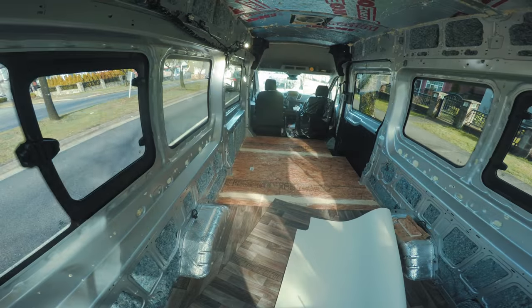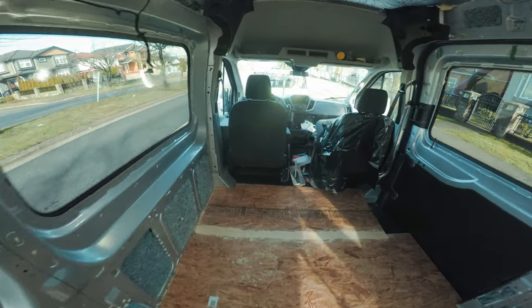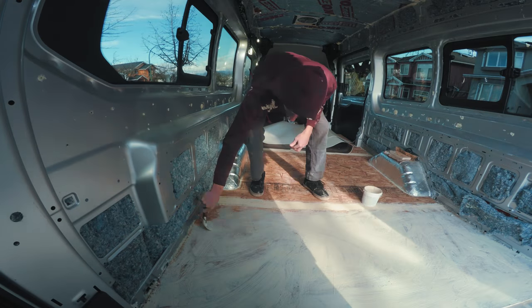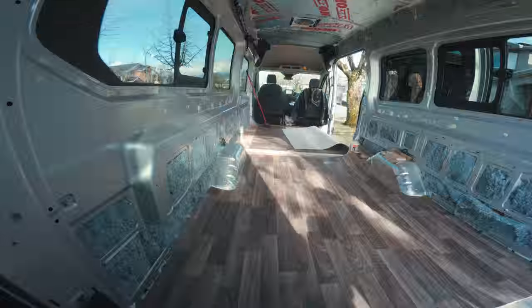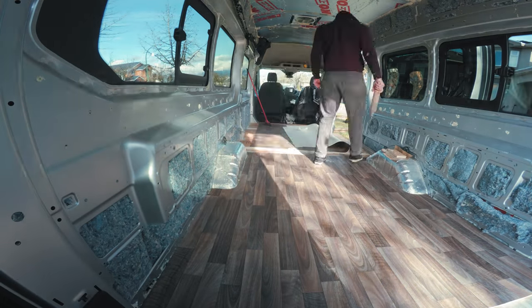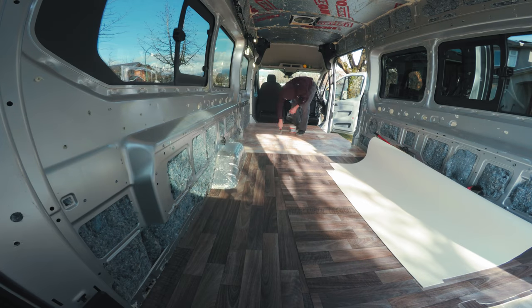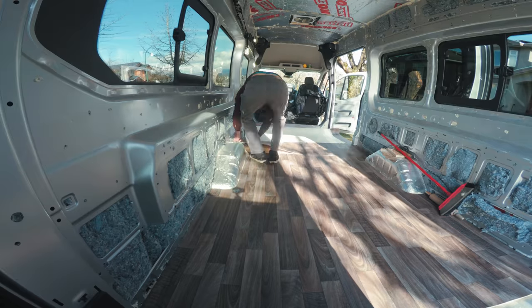In the last video we had just finished putting the insulation on the floor. Here you can see we put plywood on top of that and basically just glued it down, then filled the seams with a wood filler. Here you can see I'm laying down a specific adhesive for vinyl flooring. We had to basically cut our vinyl into two pieces to get the grain to go along with the direction of the space, otherwise we would have had to buy way more vinyl than needed for the van.